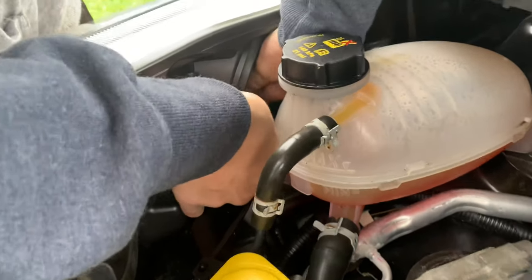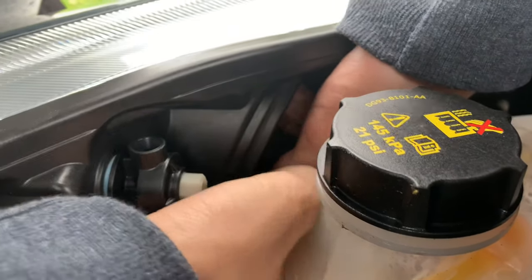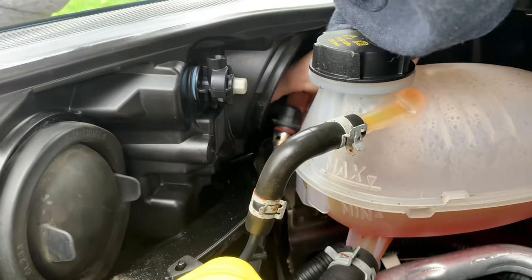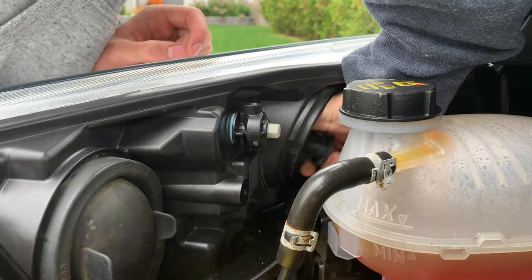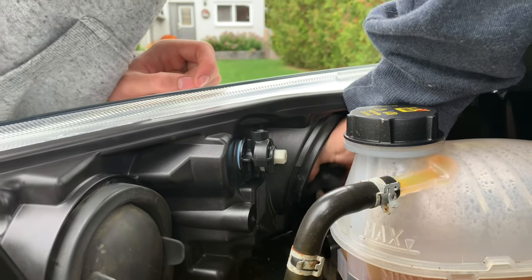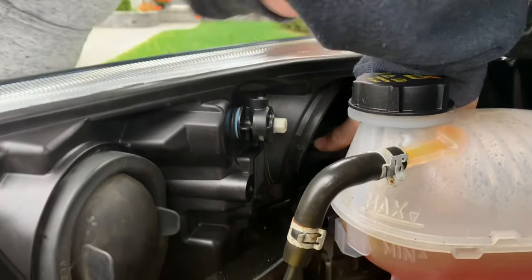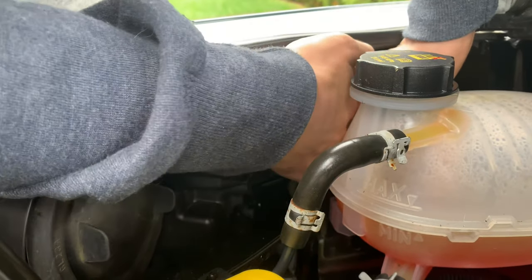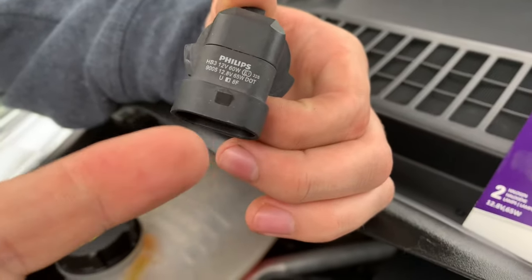There's the bulb. There's no slack on this at all, but there should be a little tab that he's got to press on. There's not very much slack here on the passenger side, but there is a tab — we'll show you here in a second. That tab has to get lifted up and pulled out. The clip lifts off of it and then pulls down.